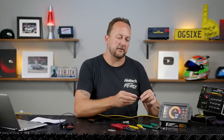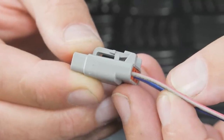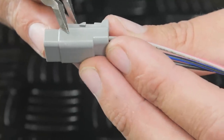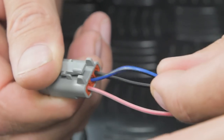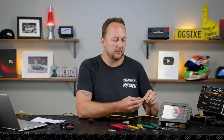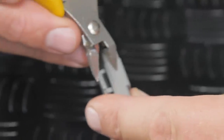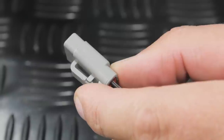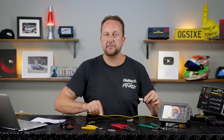I've already pre-terminated our Deutsch pins. On the side of the Deutsch connector, pin one is a switched 12-volt supply — I've picked that up straight off the power supply for the dash, or you could pick it up off the power supply for the ECU. Pin two is in the middle of the Deutsch connector and that's our signal wire — a digital output going to the speed input on the dash, or to any digital input on your ECU where you'll assign it as your vehicle speed source. Pin three is our signal ground, wired into the signal ground of the dash or the Elite ECU.